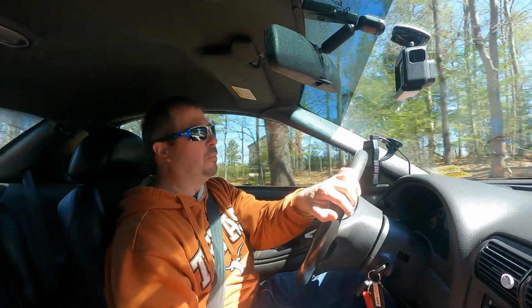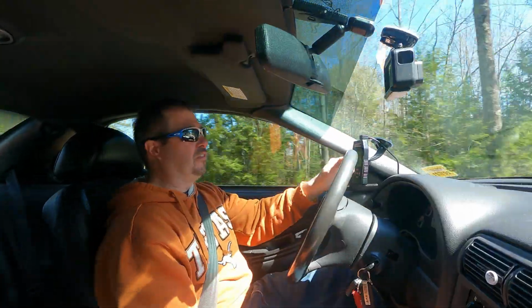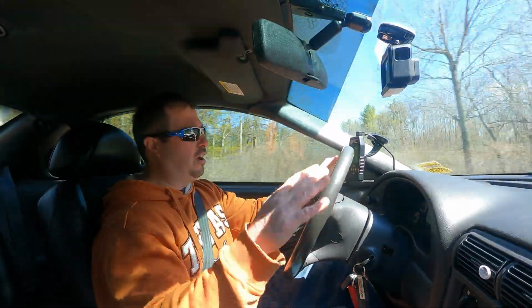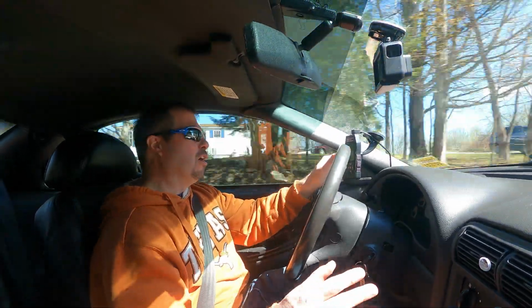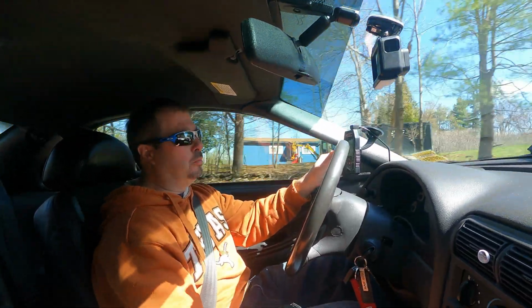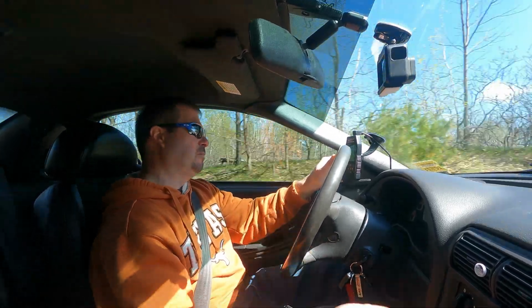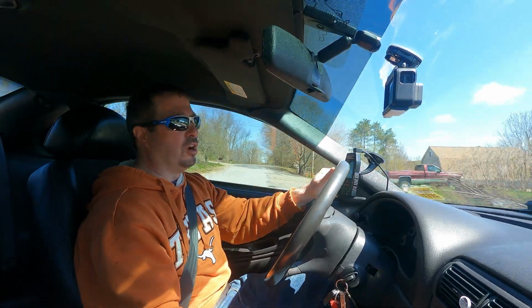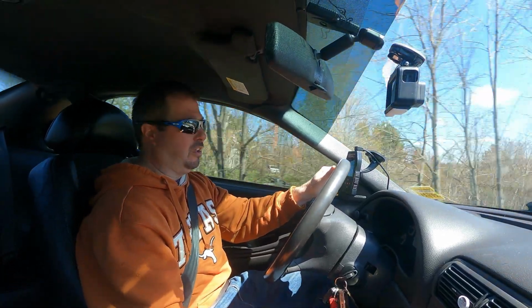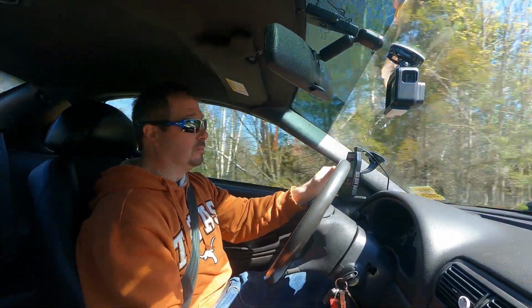Generally, most of the time when these alternators fail, you're going to start seeing decreased voltage over time. Your voltage will start dropping and eventually it's going to die. But you never know. It could be quick. It could be weeks, months. But I don't want to play that guessing game. I just want to put in a good quality aftermarket alternator and not have to worry about it.